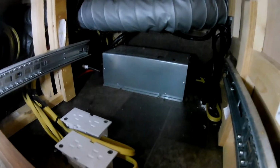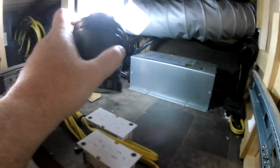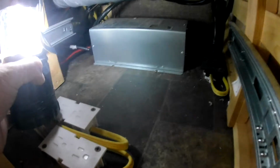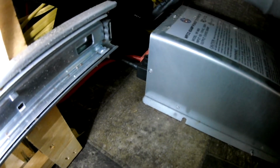So I looked inside, and I don't remember the model. WFCO. It's only a 60, I think it's a 65 amp when I pulled it up. But simple installation here. It's plugged in over to the right. One screw holding it to the base, and it's got the 12 volt connections on the left there. So it should be a simple plug and play to get that unit out. That's a 3-stage. I looked it up. It's a newer unit, 3-stage, not bad.